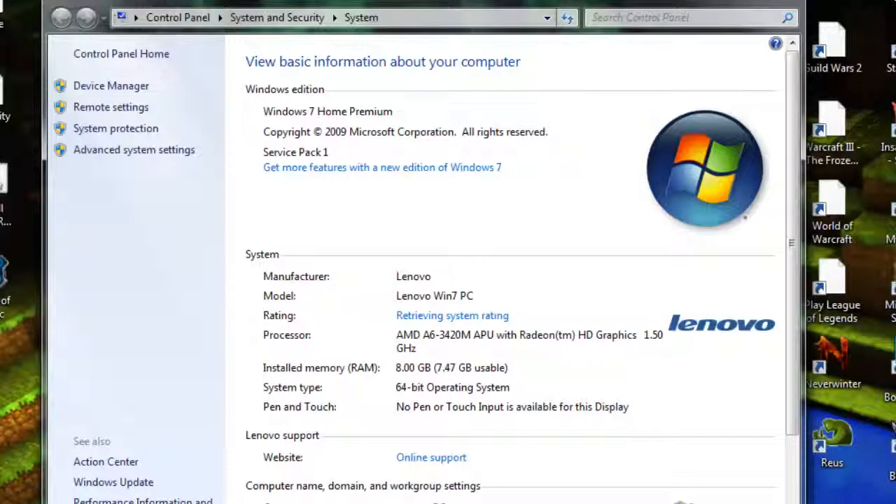Once you have the laptop RAM replaced and you're booted back into Windows, right-click on My Computer and go to Properties. Under your Windows information you should now see that you have eight gigabytes of installed RAM, whereas the previous model had six gigs. This shows that Windows is detecting the memory and showing it properly. Keep in mind that only a 64-bit operating system — 64-bit Windows — can see more than three gigs of RAM. So if you're running an older version like Windows XP or 32-bit Windows 7, you won't be able to see more than three gigs. Only 64-bit Windows 7 and Windows 8 can see eight gigs of RAM. Thank you for watching.